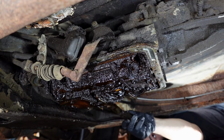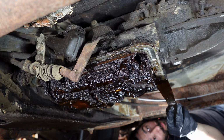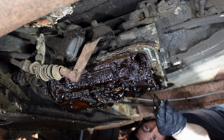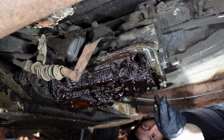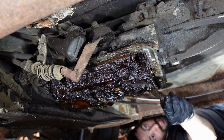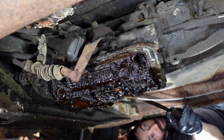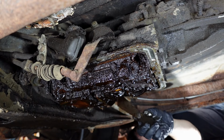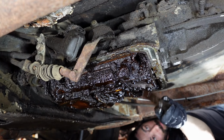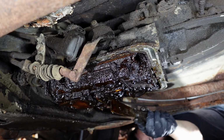And then we will do some wiping and some spraying. And I'm thinking getting under here with a can of brake parts cleaner will probably do well, because it evaporates quickly and it shouldn't damage anything. What we don't want to do is spray any kind of cleaning agent, chemical degreaser, anything. I don't know what would do what, but we don't want to take chances of spraying something up in here that's not going to evaporate, because some things won't tangle very well with the transmission fluid, and we can get foaming and things like that.